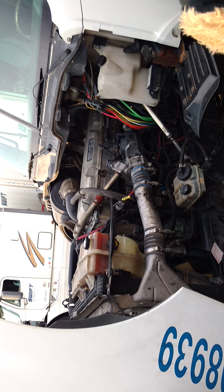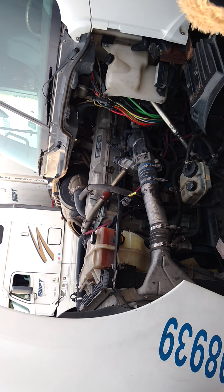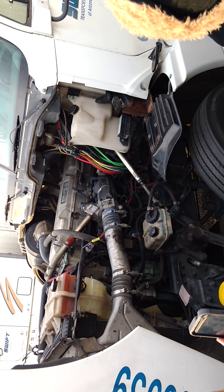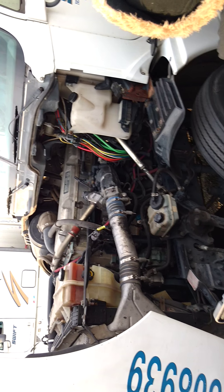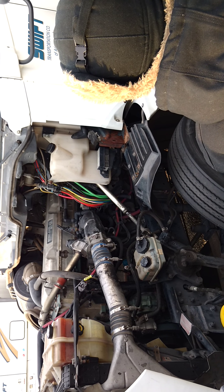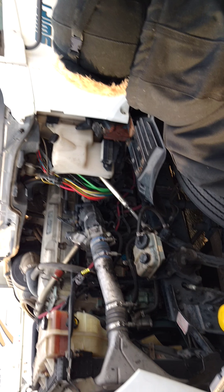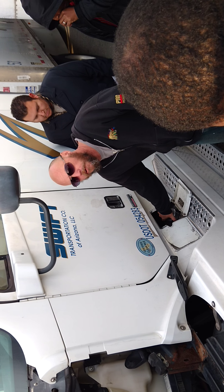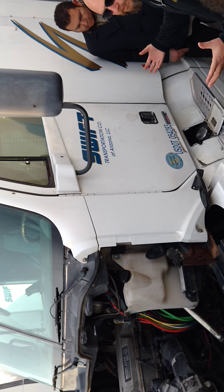The next one is the brake lining, the brake pads. It can be no thinner than a quarter inch at its thinnest point, because they don't always wear evenly. Next, I'm going to go to my ICD — that's my inflation, condition, and depth of my tire. The inflation is on the sidewall of the tire, usually around 110. The condition: I don't want any abrasions, bubbles, or cuts on the inner and outer wall of my tire. The most important is the tread depth — no less than 4/32nds.